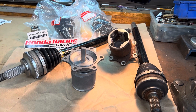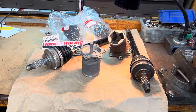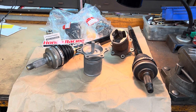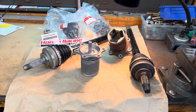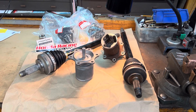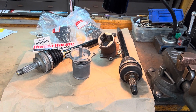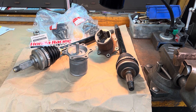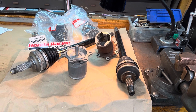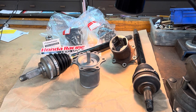Eventually you'll run out of usable area on that cup and you will have to replace the axle. Over-the-counter axles are not very good — they usually vibrate right out of the box, so they're not recommended. Buying a good used Honda axle is best if you're on a budget, even though prices have rocketed up over the last two years with the pandemic. Aftermarket axles are hit and miss on whether they'll vibrate, so always stick to a genuine Honda axle if you can.